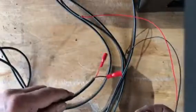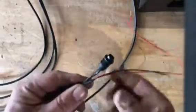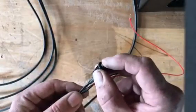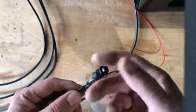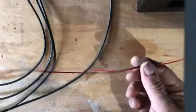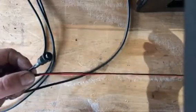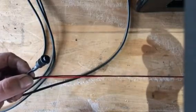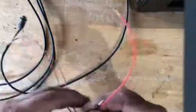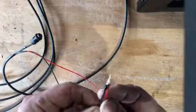That's simple — it just basically plugs onto the solenoid, I'll show you that in a second. Now, the other end, you've got a pre-wired non-locking push button. This is what activates the solenoid, and then you've got about 12 inches of red and black cable which connects to the other end. I've actually put ferrules on the end — you don't need them, you can cut them off or remove them if the cable's too big.